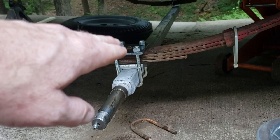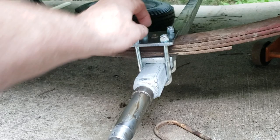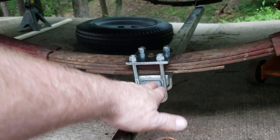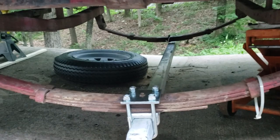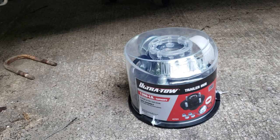Next phase: finish up the axle. It's real simple — get the axle in place, make sure your spacer is there. There's a little hole in the middle of the spacer, and the bolt that goes through the leaf spring will go into that hole. Put your top plate on, slip your bolts through, slap your nuts on, and you're on your way. Then once it's perfectly centered, measure the distance from the frame down and make sure it's the same on either side.